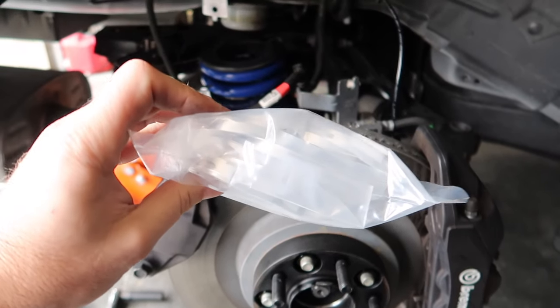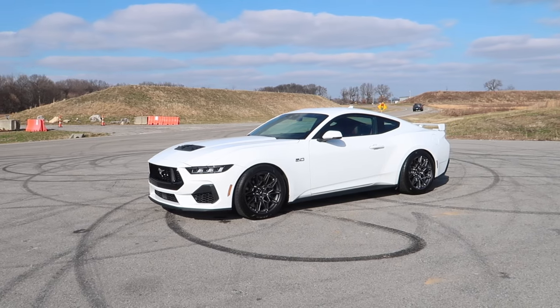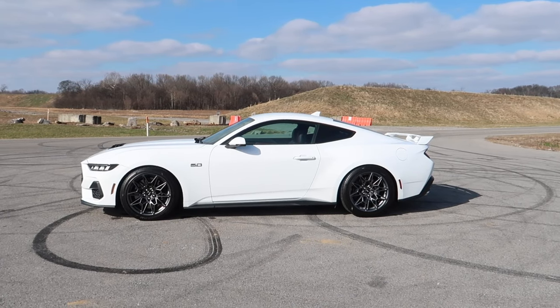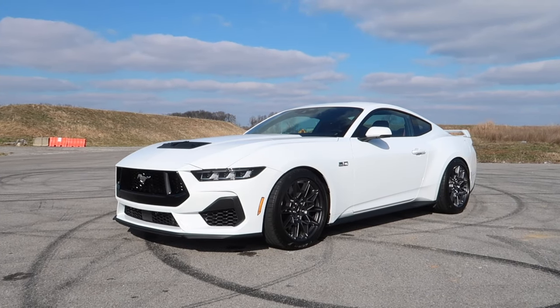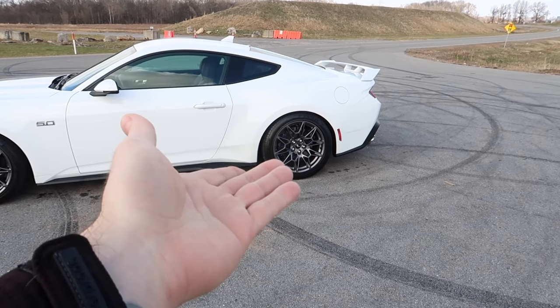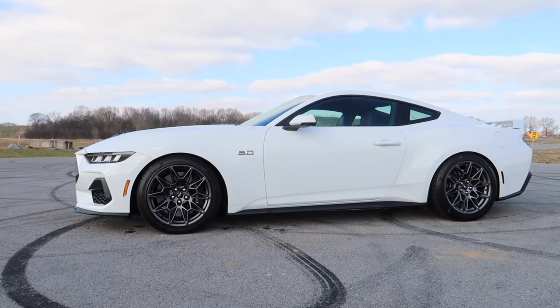Let's get to work. Light at the end of the tunnel - we've got the new Steeda shock mounts, dual rate springs, adjustable suspension with their lockouts, and the alignment kit to keep everything squared up. Everything is knuckled down tight, installed perfectly, and good to go. Also during the install I put in some eighth-inch spacers up into the spring perch to give a little bit of height in the rear. The dual rates overall sit a little bit higher than the progressives - maybe about an eighth of an inch all around.